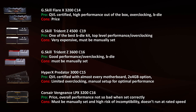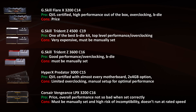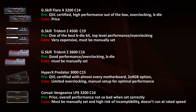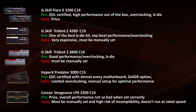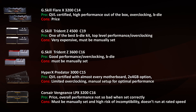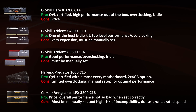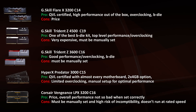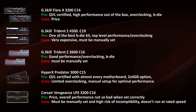If you're looking for top performance or extreme overclocking, the G-Skill Trident Z 4500 C19 is a slightly better option — I was able to run this kit at C12 timings, so it's very, very good, though also very expensive. The Trident Z 3600 C16 is a good kit with good performance and good overclocking potential thanks to B-Die, but it has to be set manually and costs about the same as the Flare X without the XMP profile. The HyperX Predator is also a very nice kit — in gaming the performance is identical or similar to the 16GB kits but at half the cost. If you're tight on budget, this is a very good option, at least temporarily.